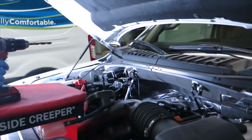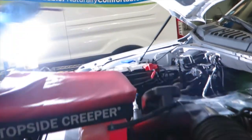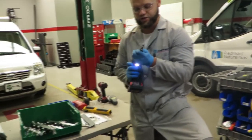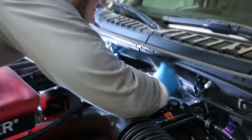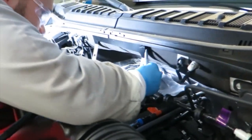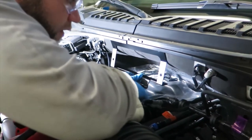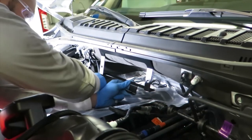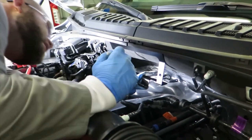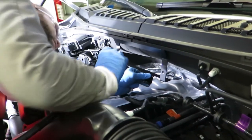Make sure you have your light set up, because without light you don't know what you're doing. Even before you start drilling, it's a wise decision to mark your holes at the firewall. This bracket will go right in the center of the intake manifold. We would measure this part and this part of the bracket, and you can see the few rows over here — it goes all the way up as high as you can push. So I'm going to mark it.